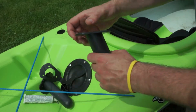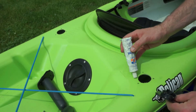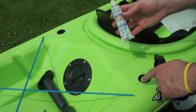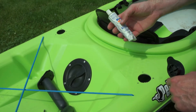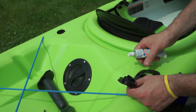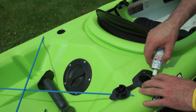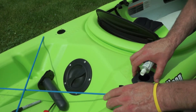What you need now is some silicone. I'm going to put silicone underneath the gasket, around the screws, and on top. I got just normal indoor-outdoor silicone — there's no need for marine grade silicone, because marine grade is for below the waterline. If you want to spend the money on marine grade, that's fine, but regular silicone works. I'll put a bead of silicone here covering the screws, set the gasket on top, put another bead of silicone on it, then slide it in and put my screws on.